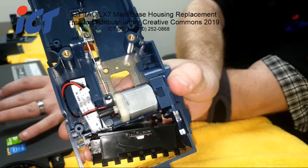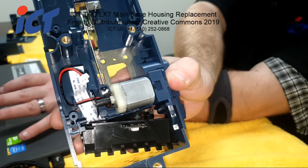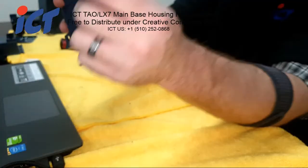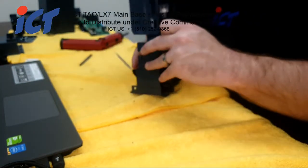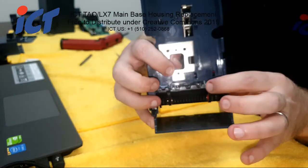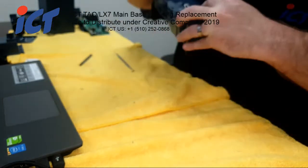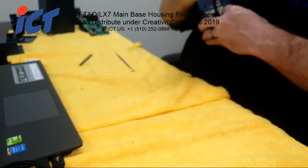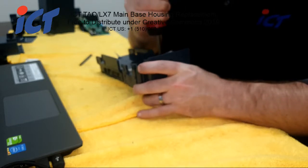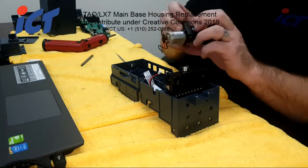So when you get your white cable routed, you want to be sure to have it underneath the drive motor wires, so it kind of holds it back away from the raster as to not bind up during operation. Alright, when that's back in flush, go ahead and put those 2 screws back here on the back. Right, and let's go ahead and do your stacker motor next.